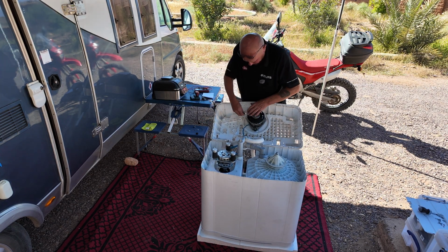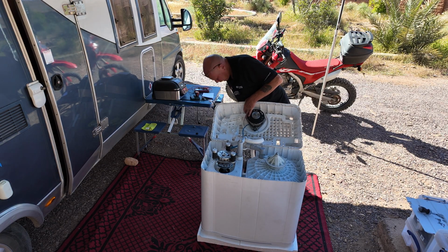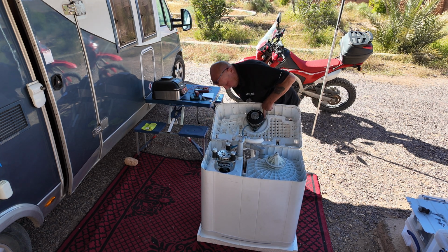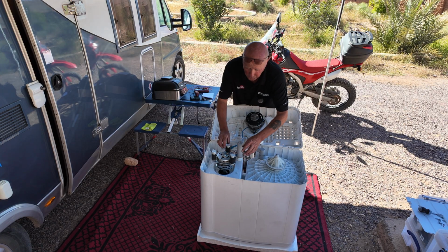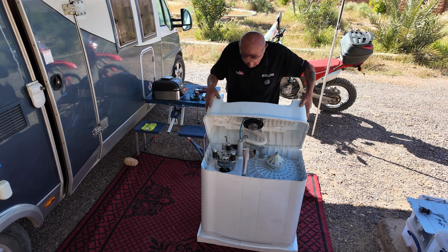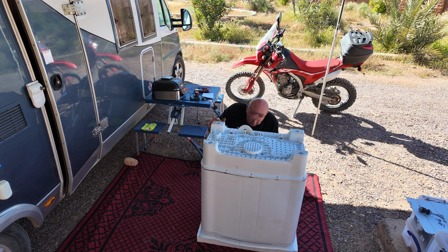Then do the next one. And then the next one. Now don't tighten it up until you know it's all in the right location. The spin motor I have got loose on the shaft, and I've also got the mountings loose as well, because you need to line these up with the pinholes on each mounting plate. So now the motor's on there, I can lean that over, make sure everything lines up correctly.